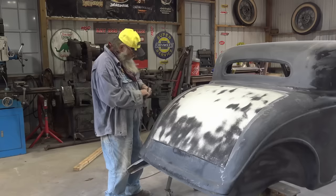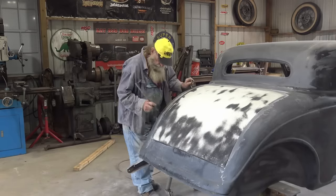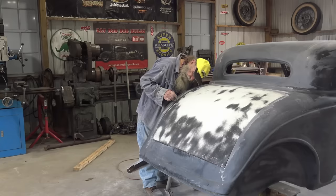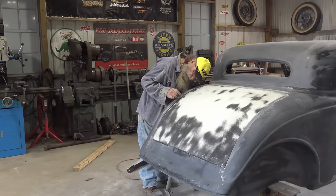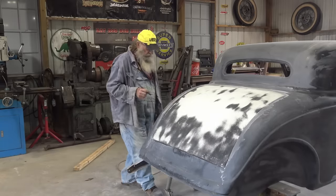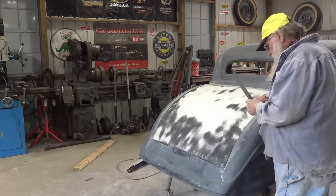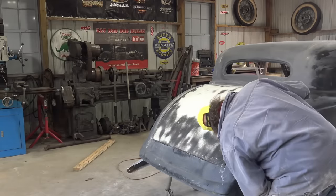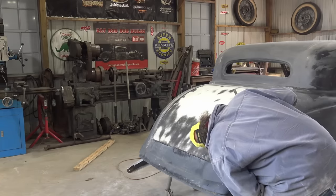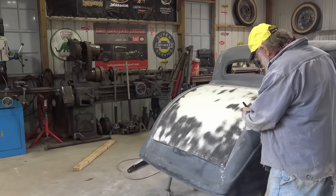Closing up a rat rod. So I'm gonna measure how much off it is and where it's off mainly. So that's a quarter inch. 3/8. Start to get back up, 3/8. Right there. So I need to make it 3/8 the other way, right there. If I check this side, like same, 3/8, about right there,